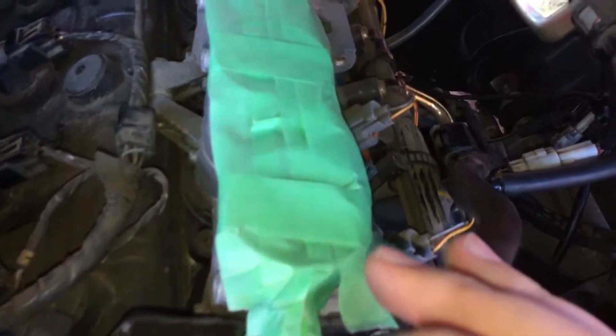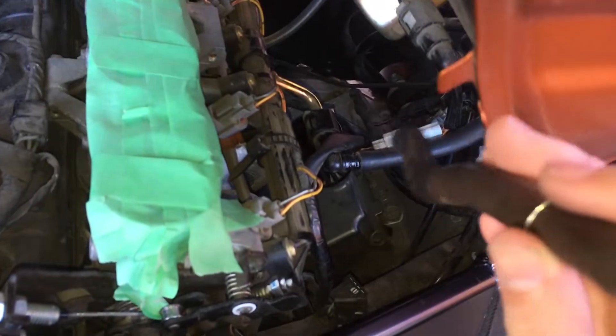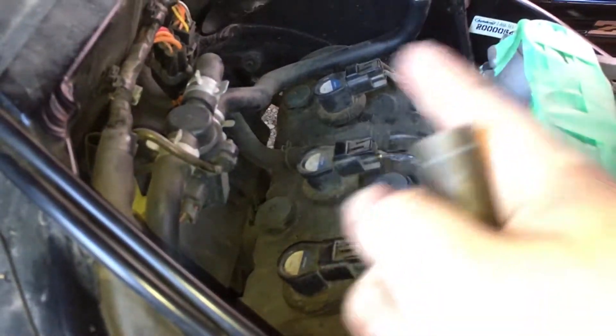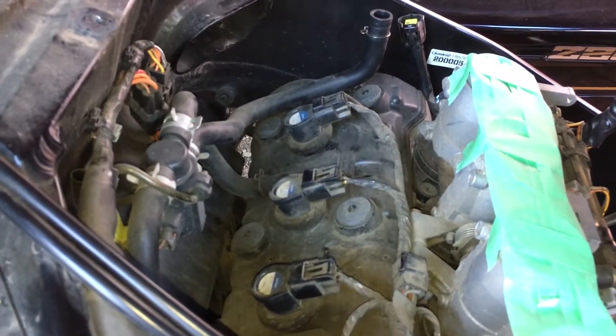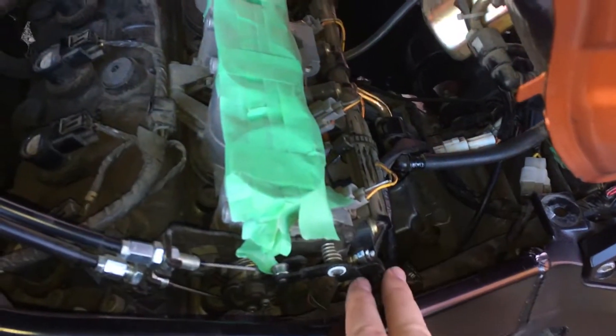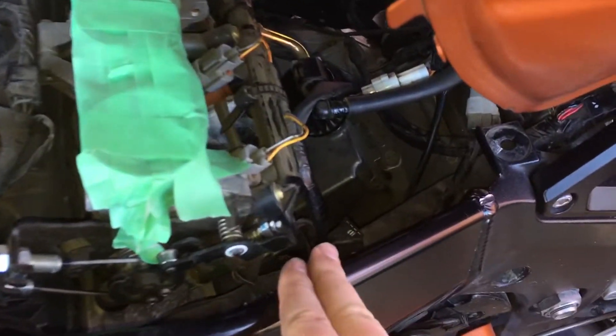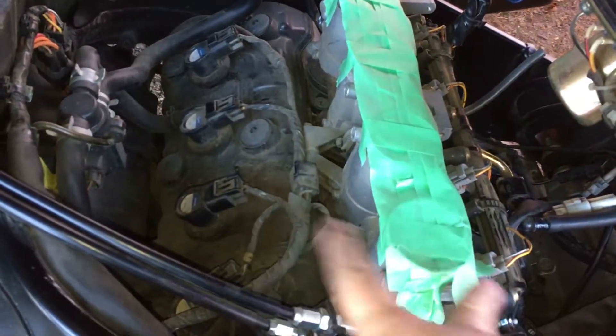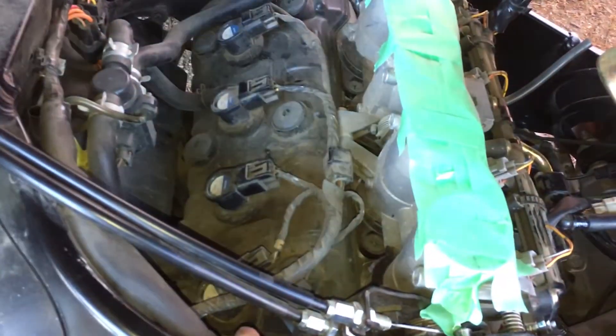One bypass that deals with both the PCV and the PAIR: you run a hose from the PCV over to the inlet on the solenoid here, and that essentially deletes your PAIR system from pulling air from the airbox. It stops the popping you get on decel and keeps your PCV under vacuum. Everyone online is saying that running the PCV to the PAIR deletes both systems while maintaining a vacuum on the crankcase.